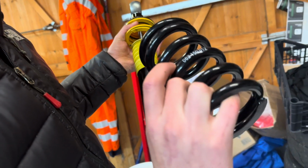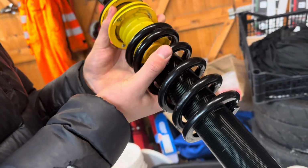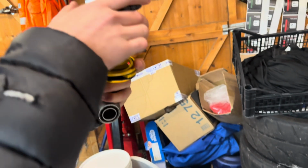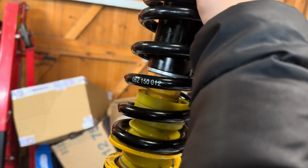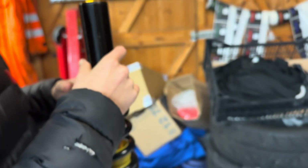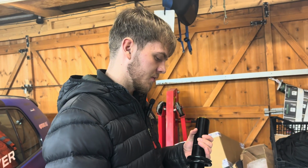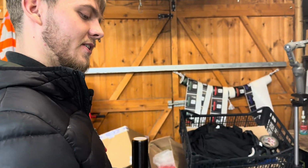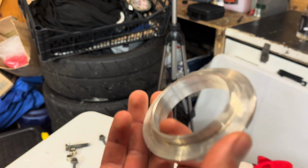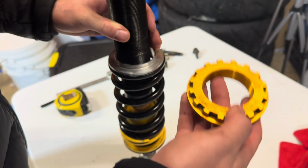Right, spring on. You want to get it so you can read the writing again, same as the other one, which is that way, because that's the bottom of the shock. Correct. Just like that. What's this 12 mean? Don't know. 12 kilogram. The rears are 12 kilogram springs. What were the fronts? I said it earlier on in the video, so make sure you're paying attention. Surely they could just rewind. No, that's cheating, isn't it? Don't cheat, guys. Leave a comment. Metal washer next, just like that. Then goes this one.